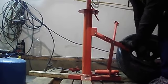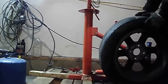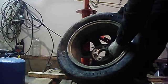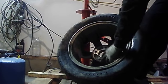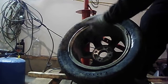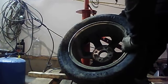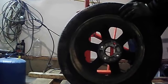and I know I'm kind of ADD when it comes to this review stuff, but I want to tell you right now before I forget, always make sure the mounting surface is clean and not corroded or rusted, because it's rare, but it can happen. If there's a lot of corrosion and rust around these points where it mounts on the mounting surface, if that stuff breaks free while you're driving, you no longer have a tight surface and that wheel can wobble loose and then you can have a wheel off, is what we called it when I worked in the shop. Which could be very bad. You don't want your wheels falling off. They're kind of nice to have on the vehicle.